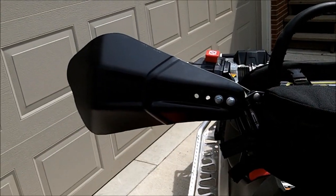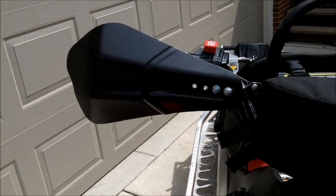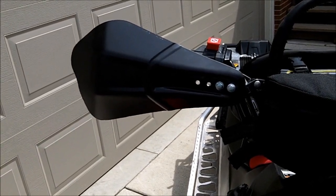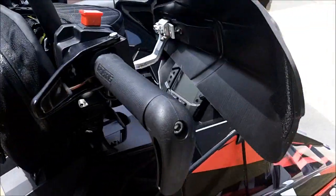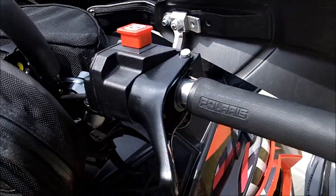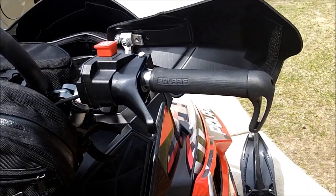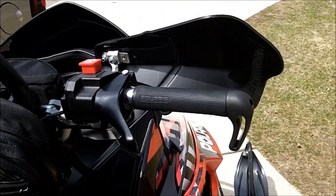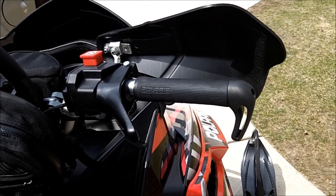From the front side you can see you've got a couple bolts there holding it to the handguard bracket. The handguard bracket itself has a set screw that holds it in place. The issue has been on the brake side — there's not enough clearance to get it up and over the brake cylinder on this particular machine. It can be done, it just takes some grinding or some twisting of the stock bracket.